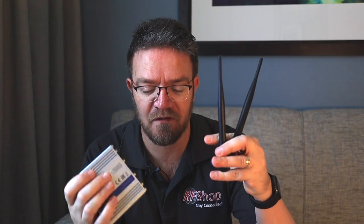Now the big thing for me is antennas. On the WiFi side, a Nighthawk only has internal WiFi antennas — if the WiFi isn't ideal, there's nothing you can do. However, with a Teltonika device, it comes with external antennas included in the box — two proper dipole antennas for WiFi. These are already quite good because you know where they're radiating; you can orient them for coverage in the direction you want. You can also replace them with higher-gain antennas or reposition them elsewhere — that's a massive plus.